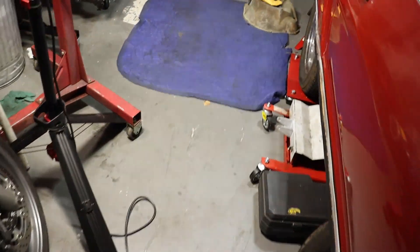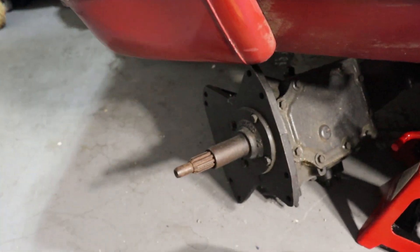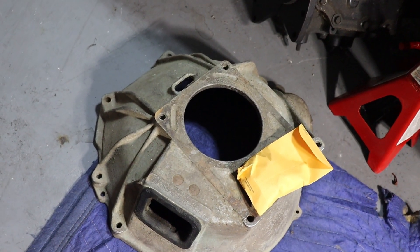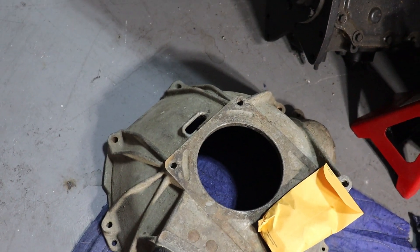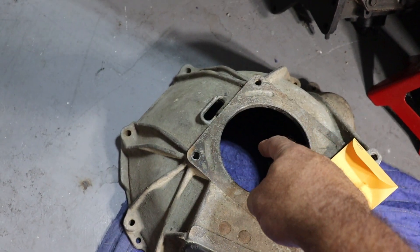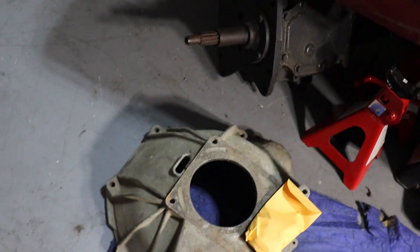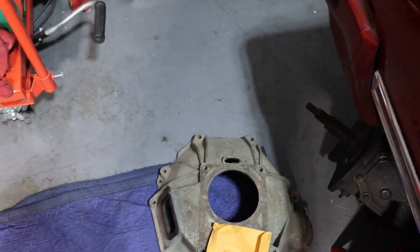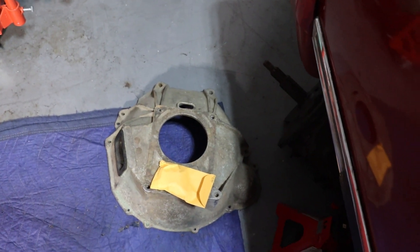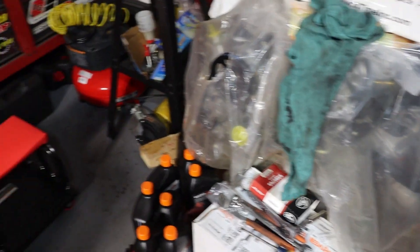My 289 in a previous life had a top loader transmission — a four-speed top loader manual — and here's the bell housing for it. What I'm talking about is this opening here, and how well this opening is aligned with the center line of the crankshaft. The top loader is very tolerant to misalignment as well, certainly not as much as an automatic transmission, but it doesn't need to be perfect. You can bolt the bell housing on the block, bolt the transmission to it, and it'll work just fine with no real concerns.